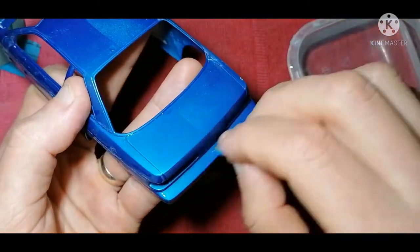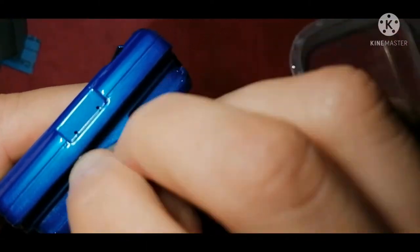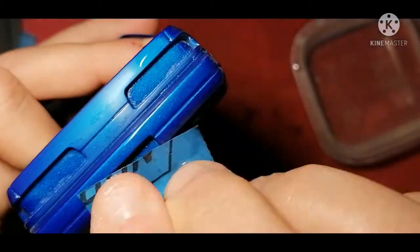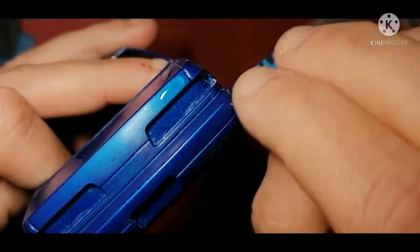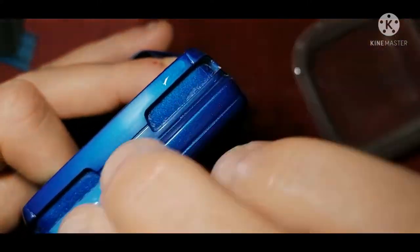There are smaller parts I won't polish, such as the wing mirrors — I will not touch those. You tend to find that with the shape and curvature of wing mirrors, once you've applied the paint you won't see any orange peel on them anyway. It just looks much smoother as it is. You'll find me sanding the bumpers here.